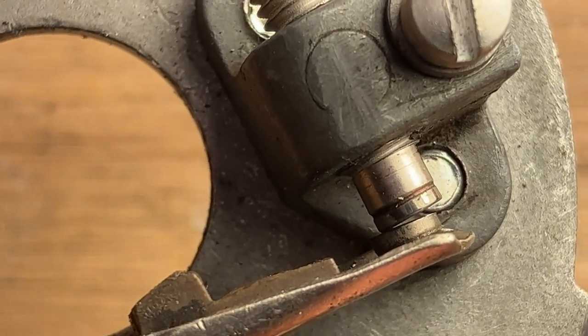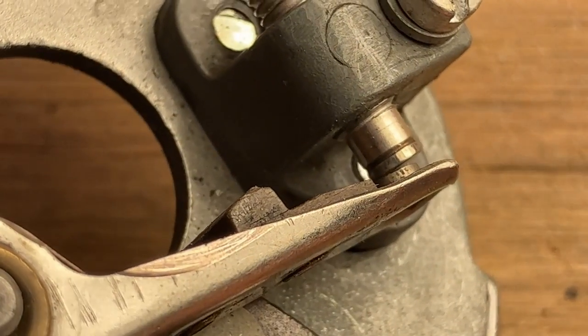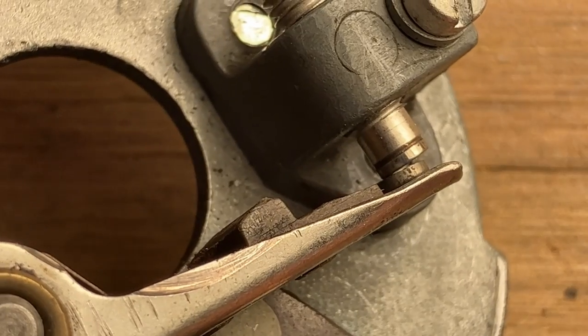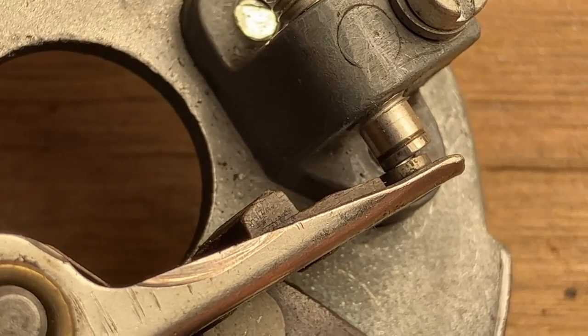Even when they meet, there's a ton of space between them. See how they only meet at the corner, that corner right there? This is actually going to make arcing more likely, and it also just makes it hard to set the point gap accurately.